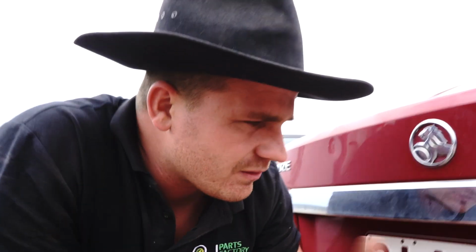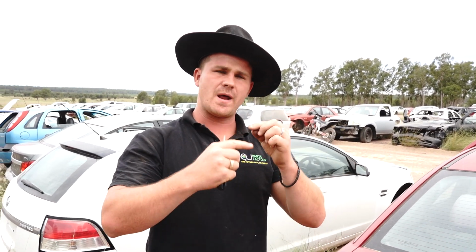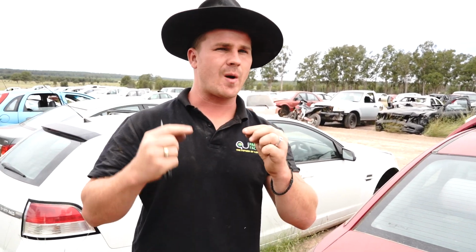That's literally it, guys. The whole job is going to take about 10 minutes, but you might need basic crimp and wiring skills. No one was going to recommend this, but you can just strip the ends off each end of the wire, twist them together one at a time, taping them up with proper industrial electrical tape, so there's nothing going to touch, no fires are going to start, etc, etc. It's up to you what you want to do. I've given you the advice, try and use a crimp set and do it properly.